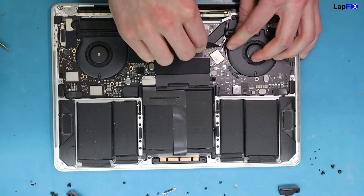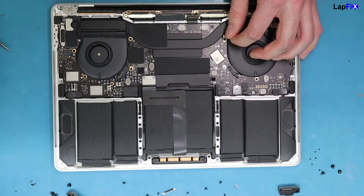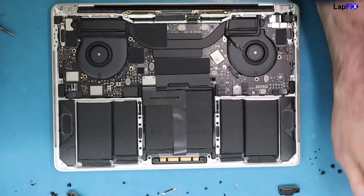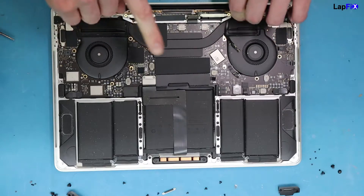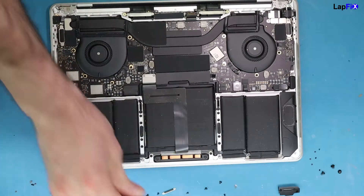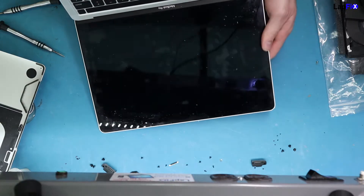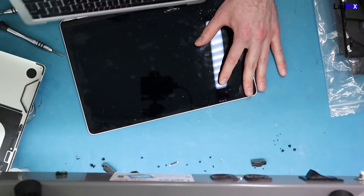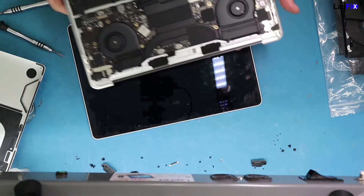The last thing: make sure you take out the antennas. Get a little tool to go underneath — it's very fragile and very easy to damage. There's a screw here that holds it in. After that, bend this up toward the front part and curl it down a little. You can just feel it and it will come right out. Everything else should be lifted up — bend it all the way out and it's going to come loose.